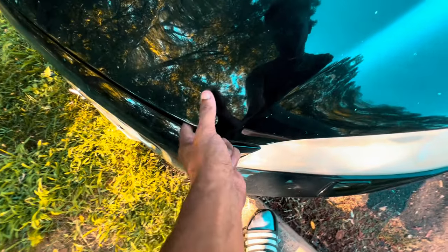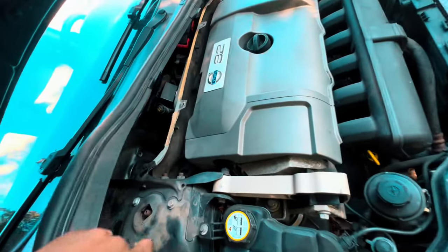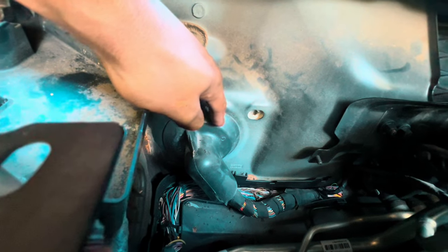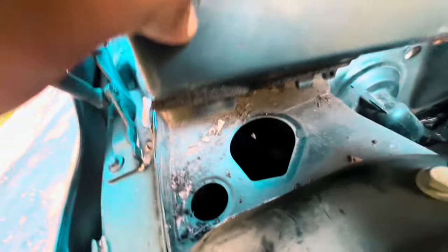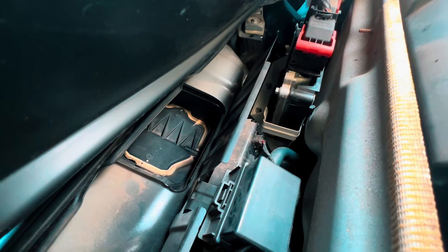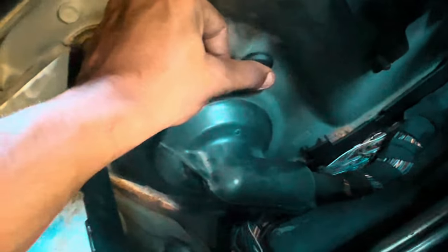She looks something like that. So I just want to show you guys something. Under here — I had tried to get in there, but don't do that. It wasn't going through, and I was going to poke a hole through the grommet. This grommet is thick — it could come out, but it's just not worth it. Unless you drill a hole, that will work. If you don't want to go underneath, you could go on this side and drill a hole, or there's another grommet right here. And this is for the Volvo V70, 2008. That just pops right back in.